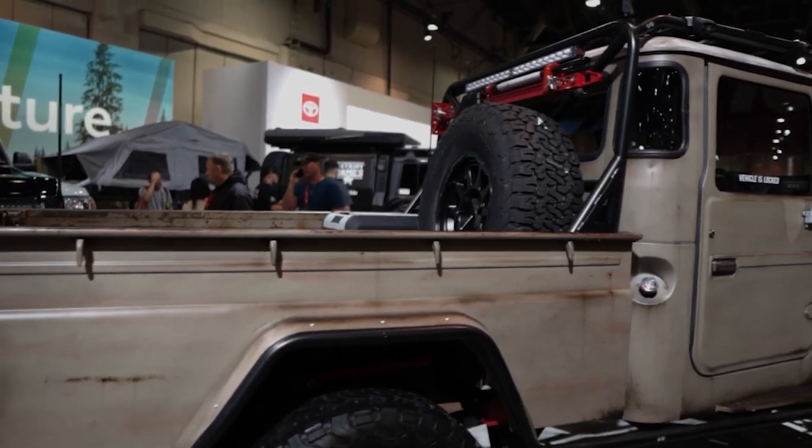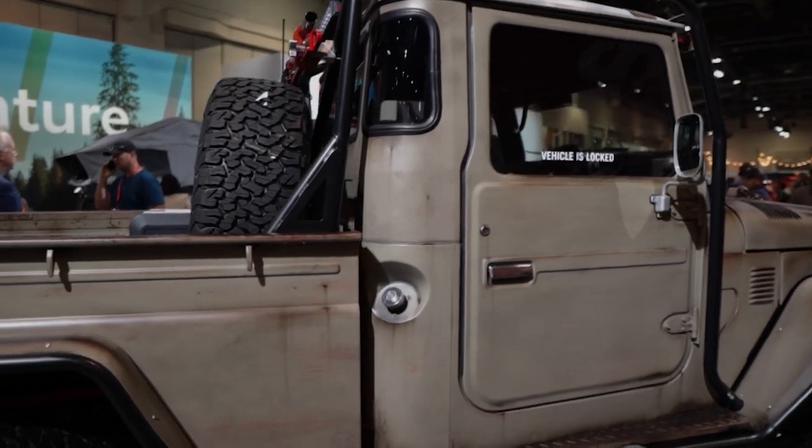So the other day we were talking about this, and you told me something really interesting about a test that you had to put this through to make sure it's road legal. So in Australia, we have to engineer our cars and make sure that they're absolutely perfect, or otherwise you can't drive them on the road. They will do you for anything that is deemed flexible, like your wheels, they can't be outside of the guards or whatever. To get this thing road legal and tested, we had to do a swerve test around some cones where they take the car up to about 100 k's an hour, which is about 60, yes, 60 miles an hour, and then swerve from one lane into another and back. And the first time it almost went wrong, so we beefed up these sway bars a little bit, and then it's perfect and it drives amazing.